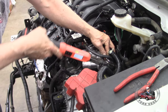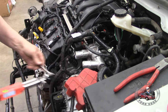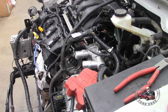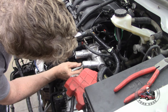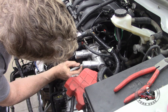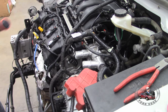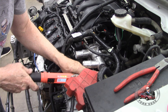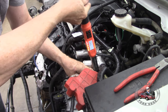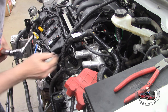71 inch-pounds is getting up there — that's quite a bit for just two little bolts, and then plus 90 degrees on top of that. 90 degrees is half of 180, a quarter of 360. That fancy wrench probably does 90 degrees — you're just about there. If he snaps it we blame Ford, not us. 90 degrees — there you go.